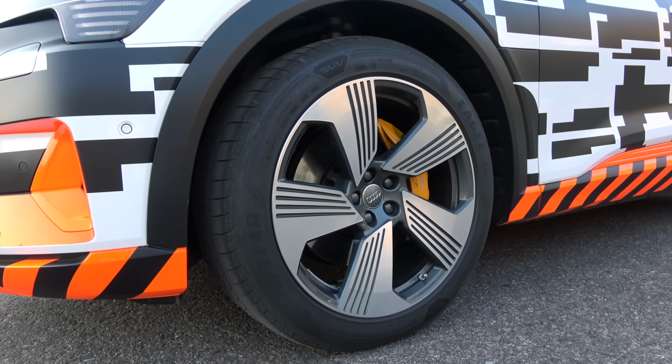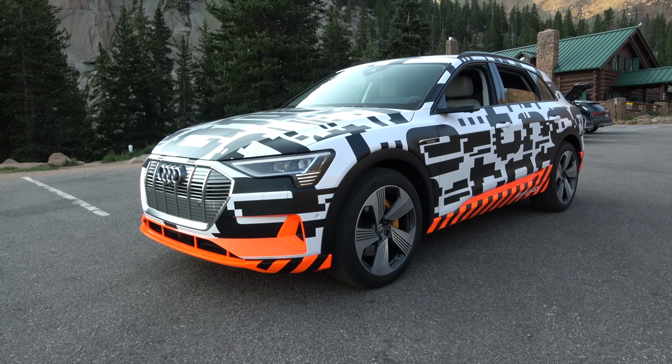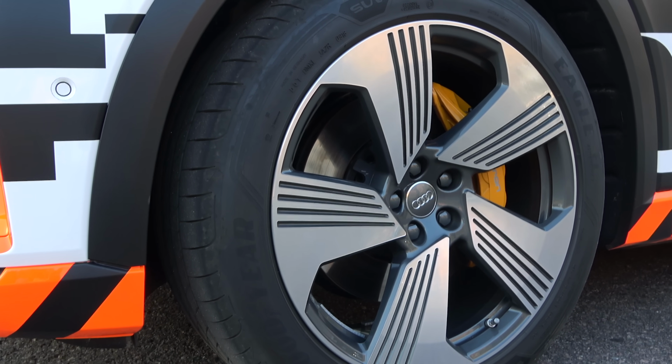And that just goes to show that really it's not using the brake at all. It's using the recuperation system. But Victor, has it felt just like driving a normal car with normal brakes? It felt like a normal car because I used the normal brake pedal. Yeah, and we didn't use the hydraulic brake. We used the recuperation, and so no heat came up to the brake. And heat is basically lost energy, isn't it? Exactly, and we put all the energy back into the battery. Bravo. You did a good job.